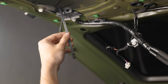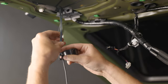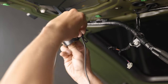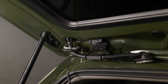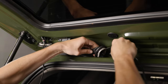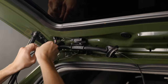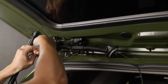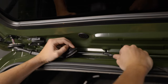With the wiring snake pulled through, grab the backup light boost bar connector, place it onto the snake, and tape it with electrical tape. With the wiring all taped up, start pulling it through. Grab the wiring snake again and on the bottom section of the grommet, start to feed it through. Do the same thing and tape it off again. Then just pull the snake back through the grommet and take off the tape.